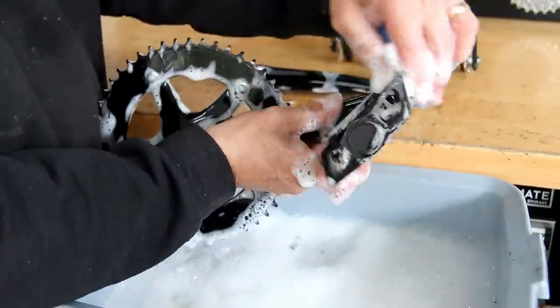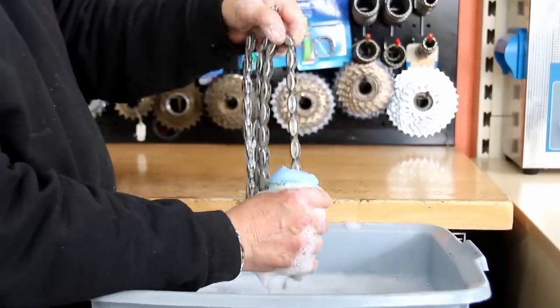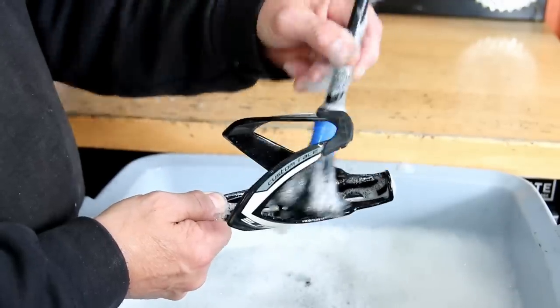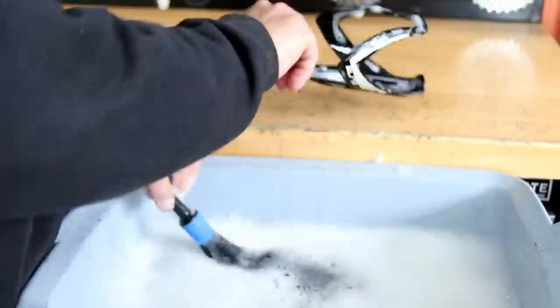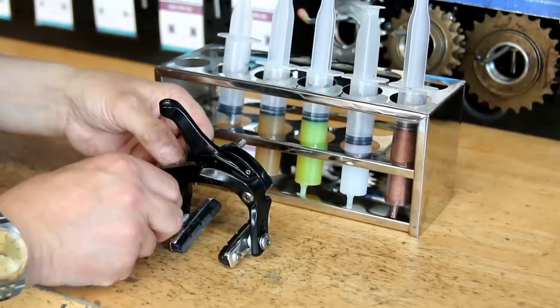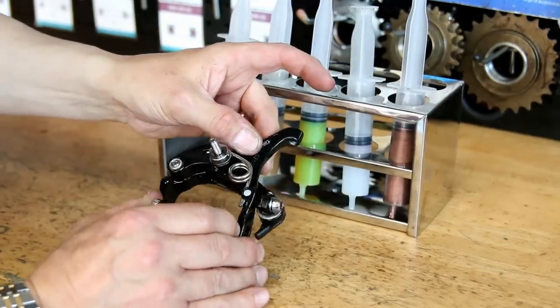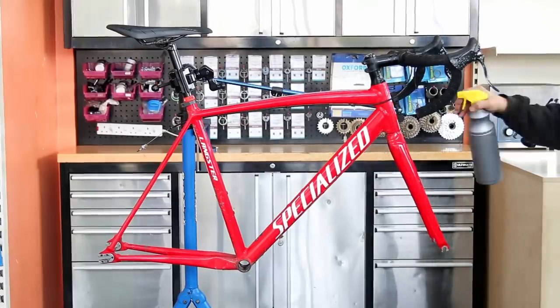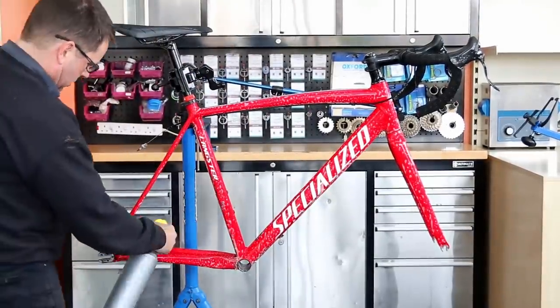After the ultrasonic cycle I wash down the parts to remove the degreaser. The pedals didn't go into the degreaser — I just washed those down so we don't disturb any of the greases in the pedals, as they were absolutely fine and didn't need any work. Then we use a thin oil on the pivot point and a little silicon grease on the spring slider for the brake.